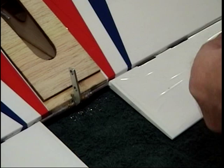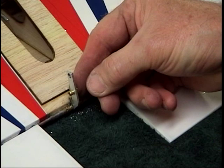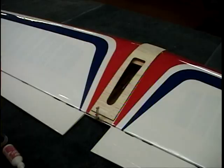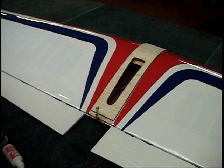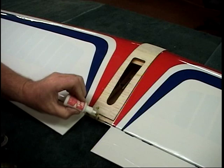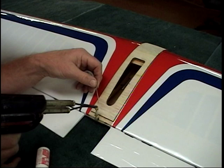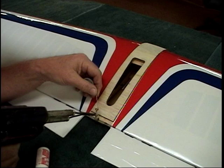It'll be a nice tight fit on the wire. Even though I'd like to have a little bit of slop in the elevators, this is going to at least give me a bushing surface so as years go by, these controls should last a really long time. I always use Stay Bright silver solder — no other solder besides Stay Bright. Deflux it with baking soda and water. This will be a longevity upgrade. I'm not sure the controls wouldn't last two or three years the other way, but I know this way they'll last ten.